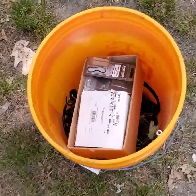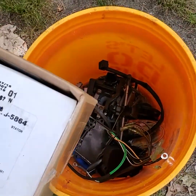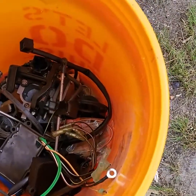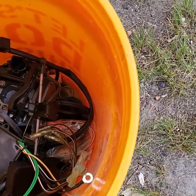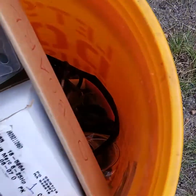Then he kind of went crazy. He threw a bucket of parts at it, literally. He brought me a bucket of parts — filters, spark plugs, stators, two different stators, the one on the engine, carburetor parts, triggers, just everything. He took everything apart trying to figure out what's wrong with it and it still won't start. So the first thing we want to do is verify that this engine is worth working on by doing a compression test.